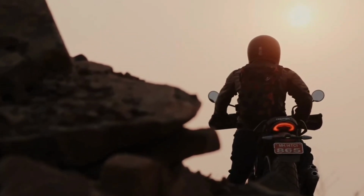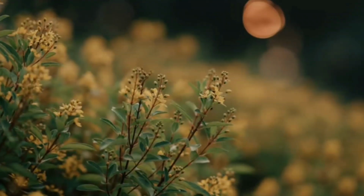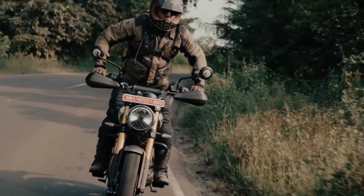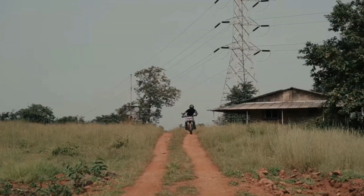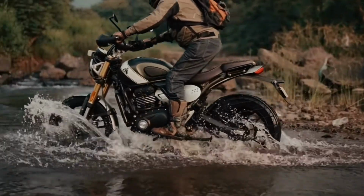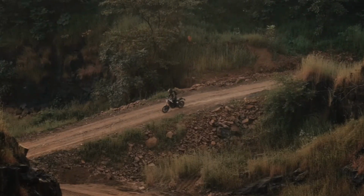it comes with a massive 320 mm disc which is paired with a radial mounted brake caliper. Even though this bike does not come with sintered or ceramic brake pads right from the factory, after riding it for a few thousand kilometers, you can opt for ceramic or sintered brake pads, which will definitely improve the braking performance of this bike.